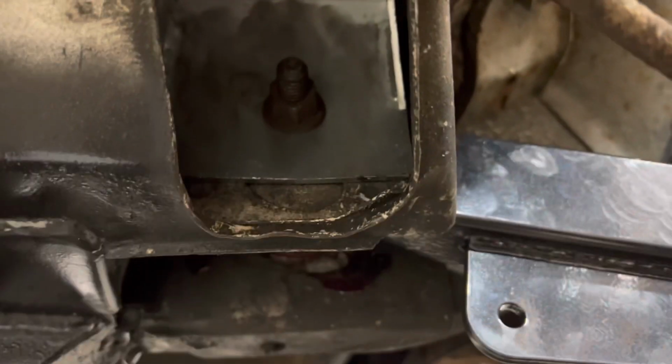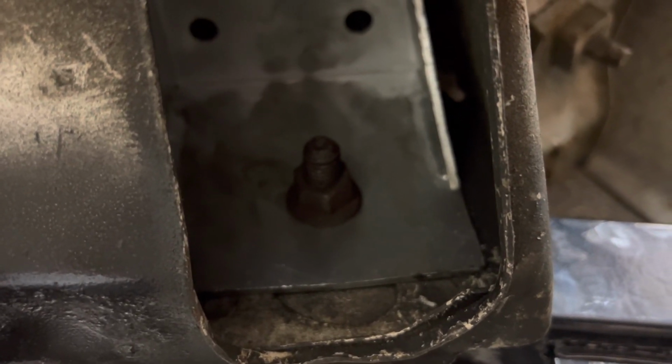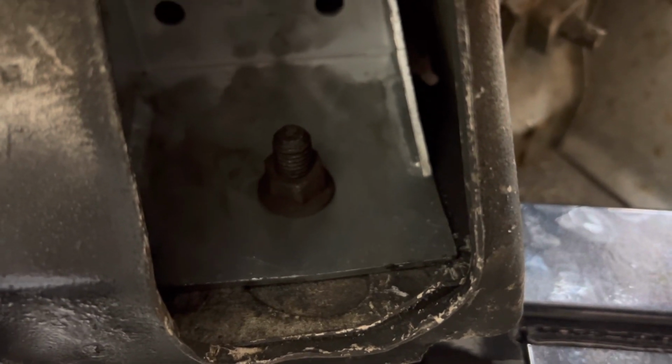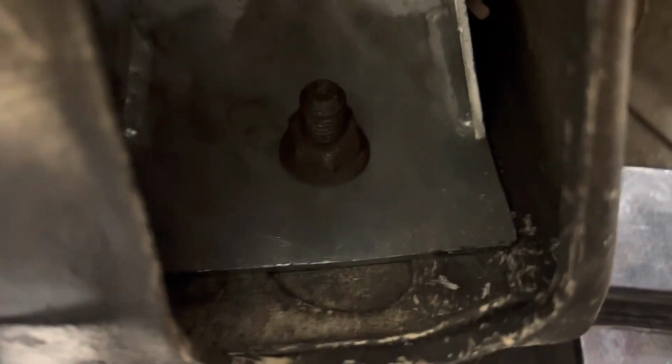And now I usually don't weld those right there. Maybe you're supposed to, but I don't. But it's in there really tight. I feel like I've got a good opportunity to hit that with a wire wheel and reach in there with a MIG and sew that up. And I think I'm going to do that on this one. And I'll tell you what, the best thing about it, I can always go back and do that on the rest of them without a whole lot of headache. Let me get the other sides bolted in the bottom. And I'll be honest with you, the best thing you could do is go get you a long bit, and you could get all 4 from the bottom.